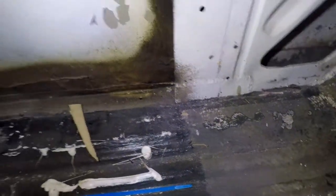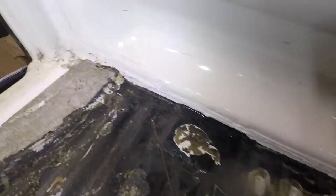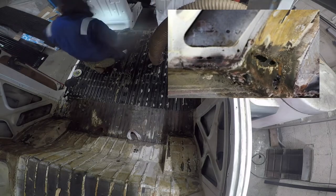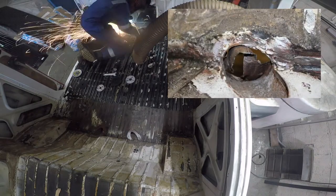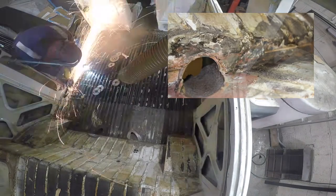It's had quite a lot of repair work to the floor and to the edges of this floor and this van, so it's nice just to get it all out and start fresh. You can see in the pictures the floor edges that I've cleaned up with a wire wheel and it's exposed a bit more of the corrosion than you could originally see. You can see where it's rotted through, where it's been previously patched — it must have been patched straight over the rotten sections.